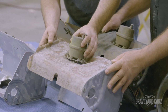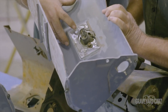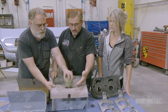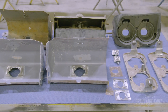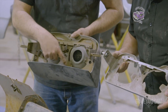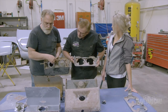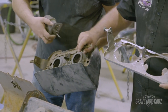But we made a bonding strip because ours is fiberglass — you can't screw into fiberglass. We made this plate here which I bonded in, so we have a stud plate for strength to hold it in place. Now you just put your nuts on there and you've got exactly the same amount of strength, if not more, than the original had. It's a multitude of parts — it's not just an erector set that you're bolting together, but you do have to make modifications to it. This plate here made out of fiberglass is a very nice piece, but we needed this mount here for the end of the actuator to clip onto, to drag that door up.